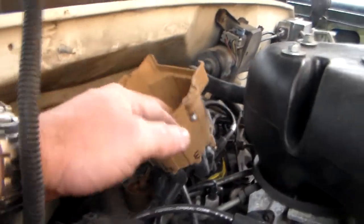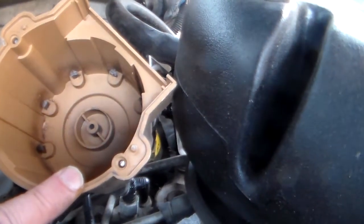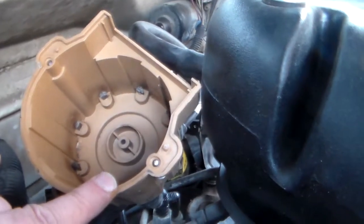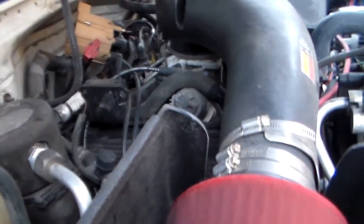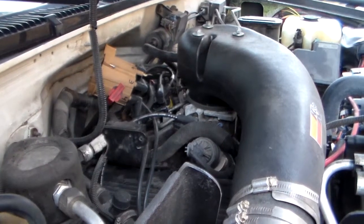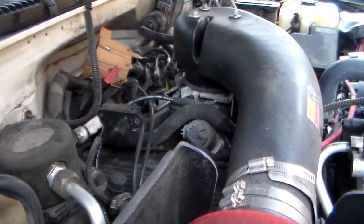Let me see if I can get a better view of that for you. There's the distributor cap — I can't really reach it. But that little center pin in there, there's barely anything left sticking out of that little nipple. So maybe it was there, and that final turnover just fried it and blew it off, because it looked like a little piece of carbon tip or something on there. It wasn't metal or anything, so I'm pretty sure that's the problem.